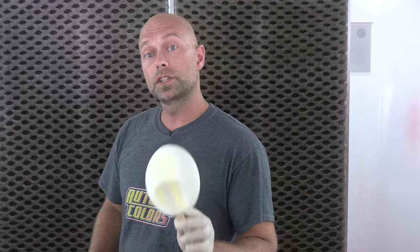These shapes are ABS plastic, so we just gave them a quick scuff with a red scotch pad — that's what we usually recommend for doing plastic. You don't want to lean on it, you just want to dull the surface. Then wipe these down with a water-based wax and grease remover; the water base helps neutralize the static charge because this is plastic. We tacked them off and we are ready to spray. For my first color I'm going to do our silver sealer, our 6013 silver sealer, and that goes directly to this plastic.